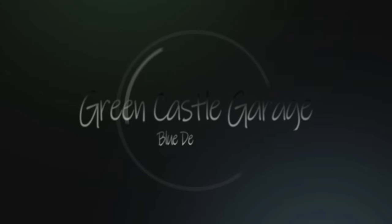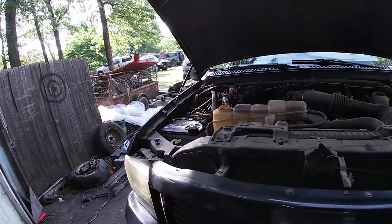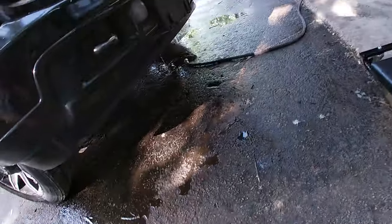This video is brought to you by... Last night we saw a lot of white smoke coming out of that tailpipe. Not sure if my sister left the drain pan under — she did — you can probably see that oil there. The oil looks like chocolate milk, so needless to say the head gasket on this puppy's blown.